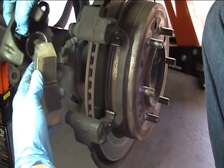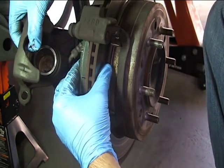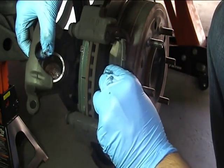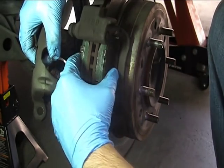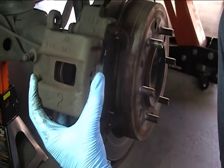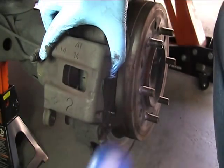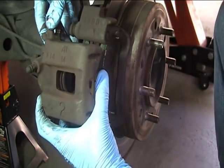Get these back into their grooves and once you've done that they'll slide right in. This one goes in at an angle — it'll straighten out and then slide back in. If you need to depress the piston, the easiest way is to remove the brake pads, screw the caliper back on, and then use a screwdriver to push the piston back in. That'll open it up nice and wide so you can get the new brake pads in without a problem.